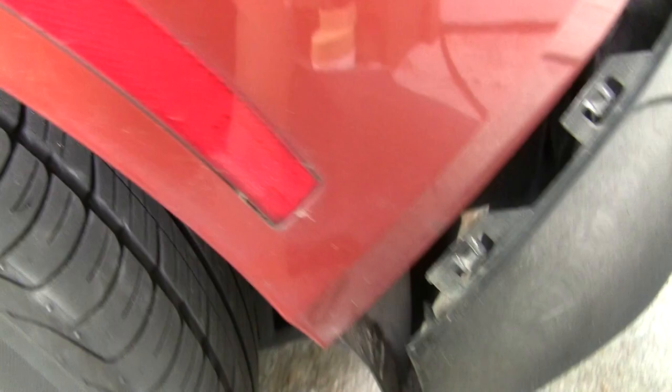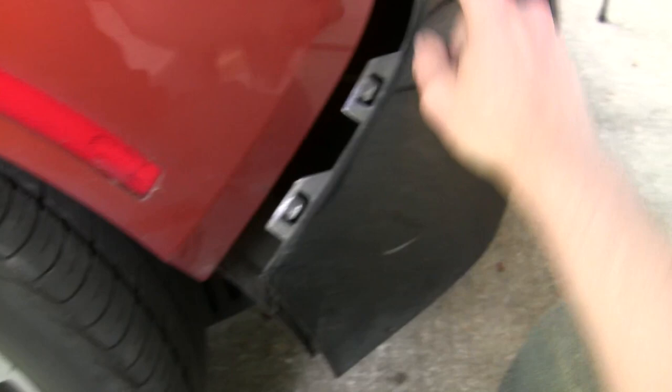The only thing really remaining holding it on is in there. You see where my index finger is? There are little latches that you need to squeeze and disengage so it'll pop off. You just reach around inside here and pull this mud guard out of the way — there are four of them. You just reach up in there, squeeze it, pull it out. They're not hard to get out. If you're struggling, make sure you're pushing very slightly on here — it's not a very aggressive clip. We're pretty loose already.